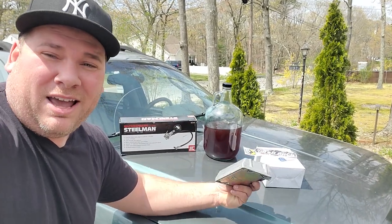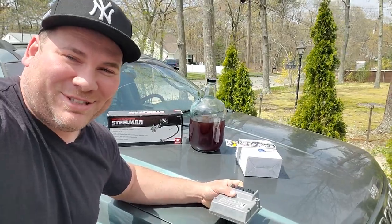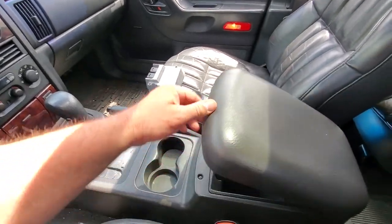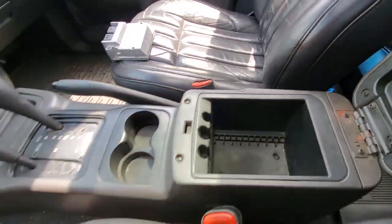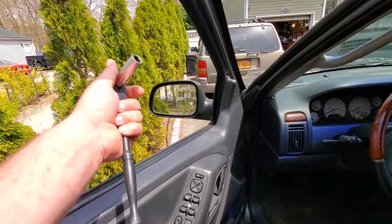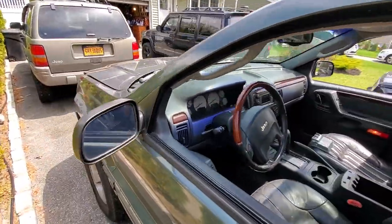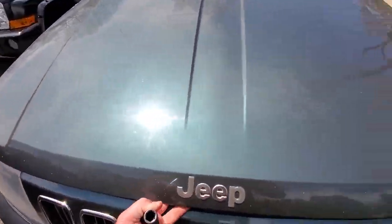Since we're going to be dealing with an airbag, the first thing we're going to do is pop the hood and disconnect the battery. Before you do an airbag module project you're going to need a new airbag module — more on that in a second. You're also going to want to empty your center console, and if it's on a hot day you're going to want to open up these windows before you disconnect the battery. You don't want to smother yourself — too hot for that.